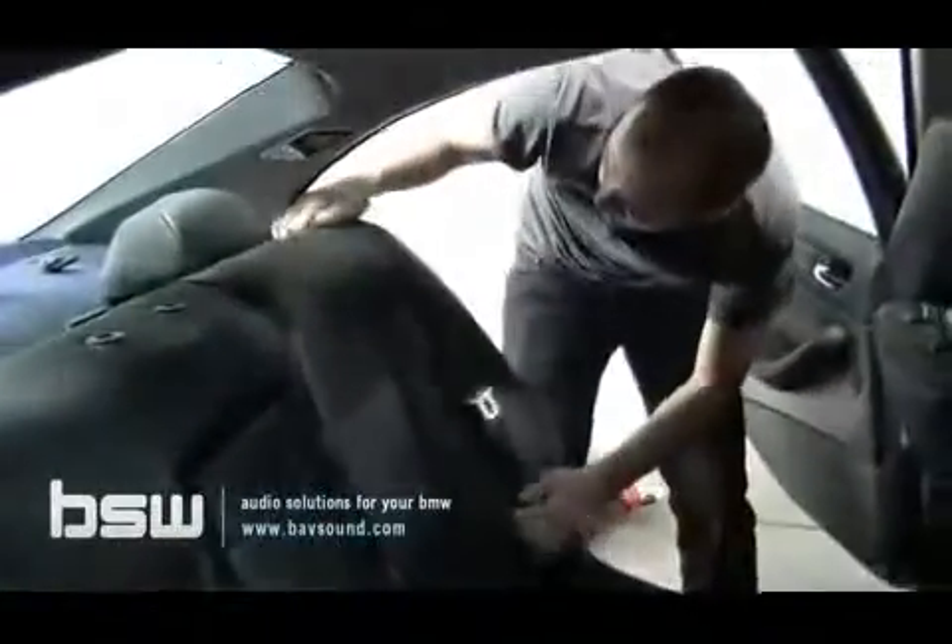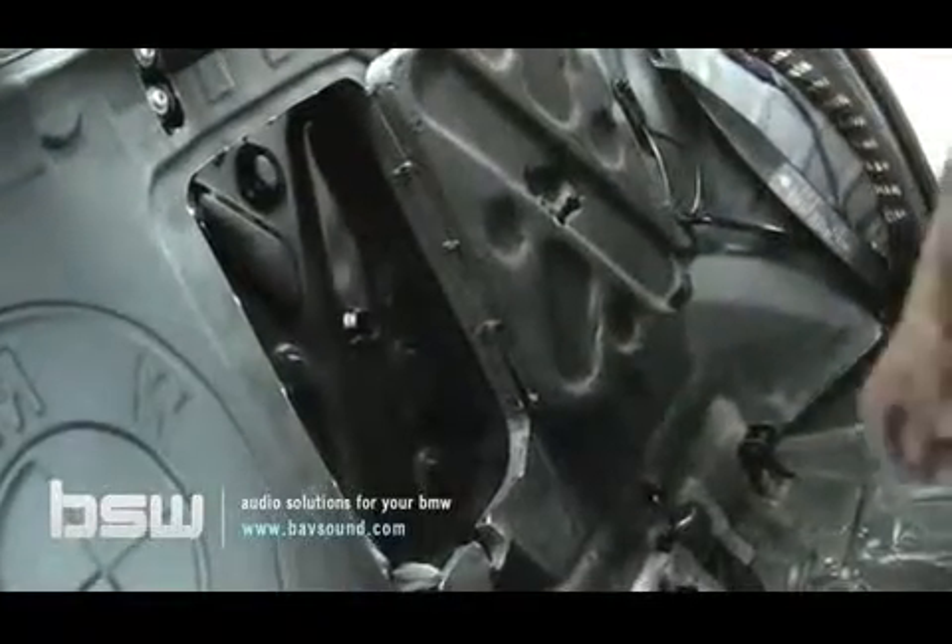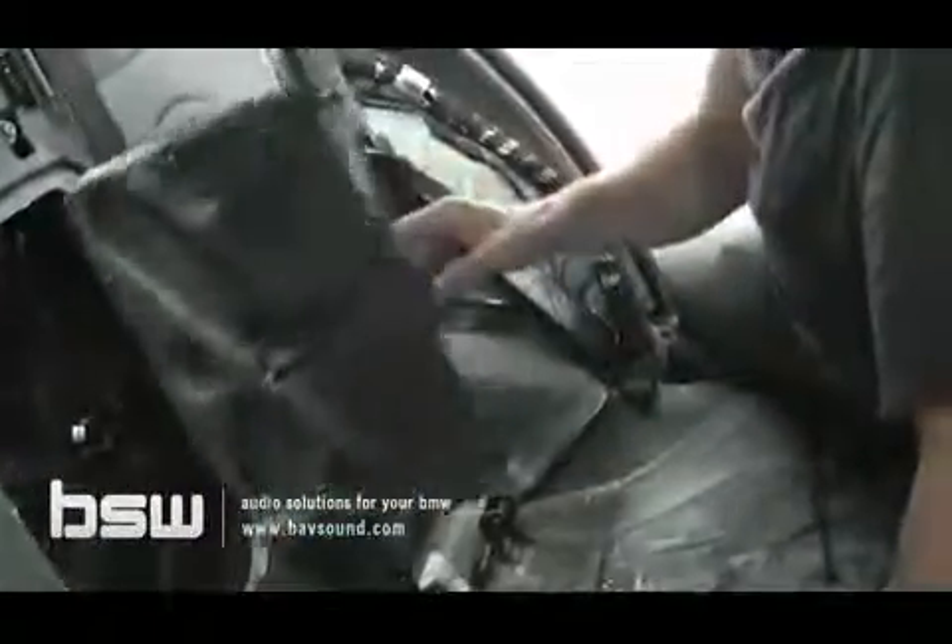Just lift out towards the front of the car. We're going to unhook the seat belts and then just lift up — be careful not to scratch anything, mainly your doors. This is also a good time, especially if you're installing one of our D110 subwoofer systems, to pull out this piece of insulation. You can see here this perforated metal — knock that out, it lets the pressure from the woofer come into the cabin. You just need a hammer or mallet and you can bang this right out; it won't affect the rigidity of the car — it was designed to come out. That's where the ski pass would be if your car had a factory ski pass. And here's that grommet we were looking for earlier.